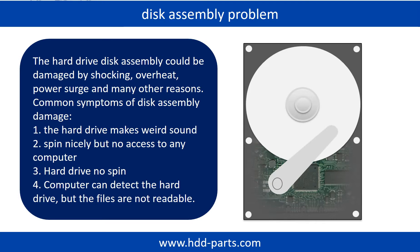Tips: If the storage is configured as mirrored hard drives, you can take the bad hard drive out, then put a same size or bigger hard drive into the bay, and the storage will mirror the data to the new hard drive automatically. If this trick doesn't work, that means the two mirrored hard drives are both damaged, or the storage was configured as RAID 0, meaning the two hard drives are striped.